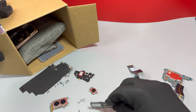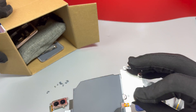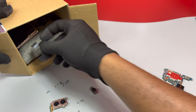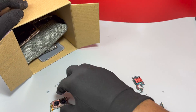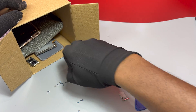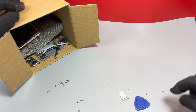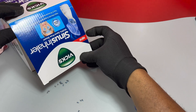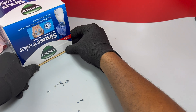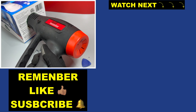For those suggesting using alcohol to remove the battery: alcohol can work, but you need to be careful about placement. I suggest applying the alcohol on the side of the battery using a small amount — do not flood the battery with alcohol. If you flood it, the alcohol can damage the in-display fingerprint sensor or find its way between the screen and the digitizer, at which point the screen is no longer usable.